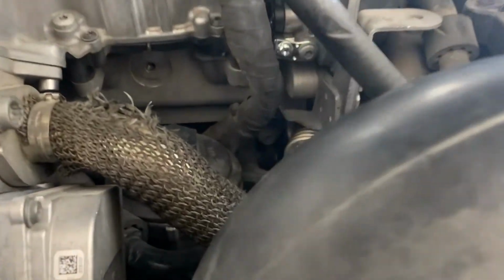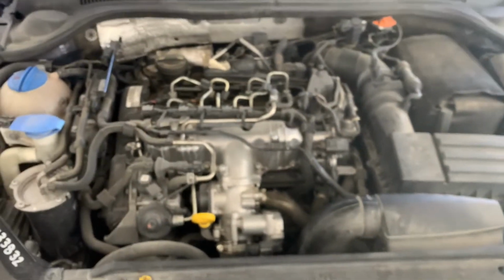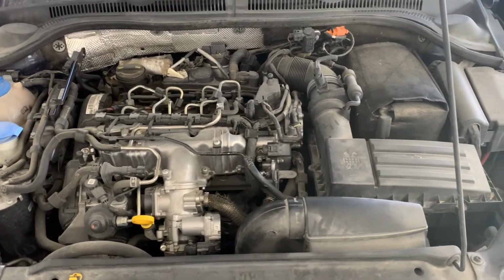All right. So we got that on there. I found if you start the car, it will pull that lever towards the front and bring the top towards the front of the car. Makes it a little easier to get it positioned in there, because when it wore out, it wants to go a little further and you're kind of fighting it to push the arm back up. So, little tip there. But that should keep my check engine light off, at least for the P2015 code.